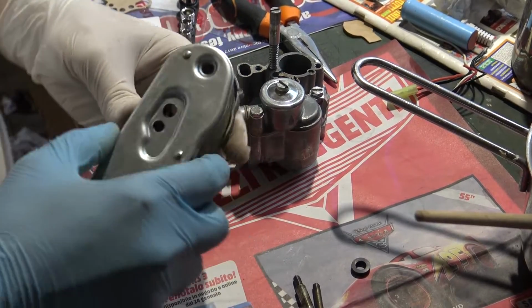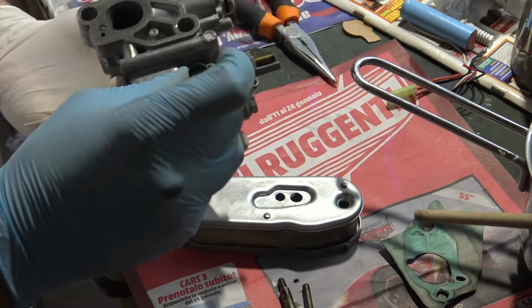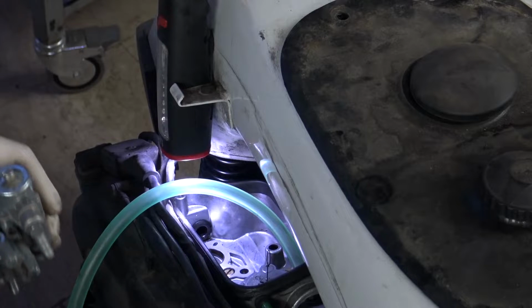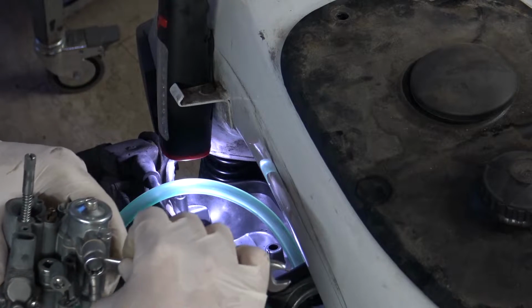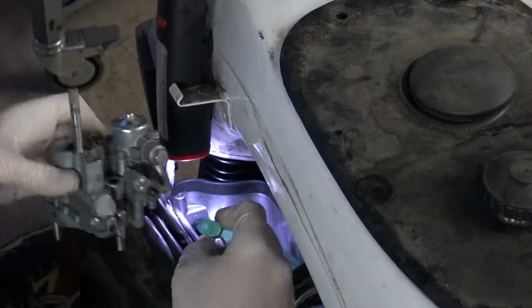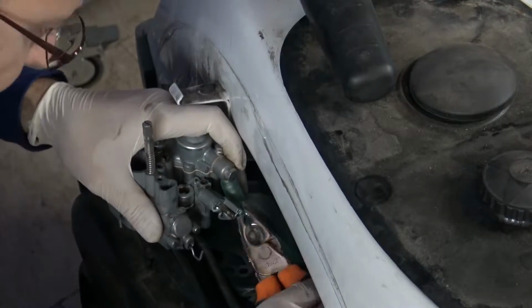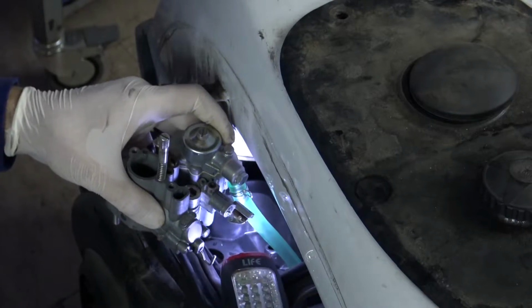Quickly into the air filter, a quick blow and it's finished. There is also a rubber hose which goes below the carburetor, which must be connected in the base of the engine block. Once you find the correct position of the fuel hose, you may tighten. Before you connect the hose, insert a clamp. This will avoid the disconnection of the fuel line due to the vibration of the engine. Insert the hose until the end and block it with the clamp. Like this, it's a good job.